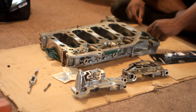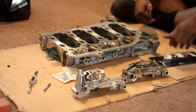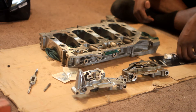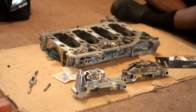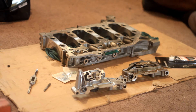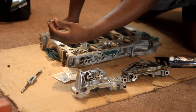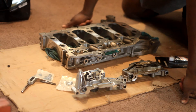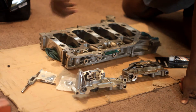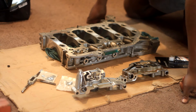I'm sure there's an exception to the rule, so it's for you to go out and do your research and go from there. The tools I will be using — I'll show you what I'll be tapping on the girdle. I went with a 7mm bolt with a one-pitch thread. I bought these bolts from Lowe's — came to like two or three bucks — and the tap and die set. I'll give you guys a close-up of what I'll be doing.